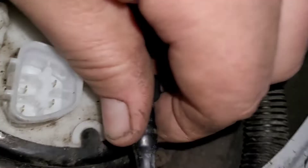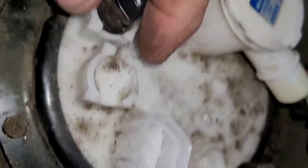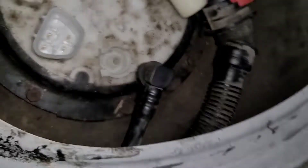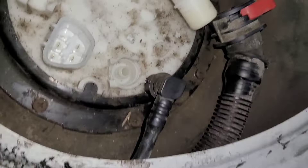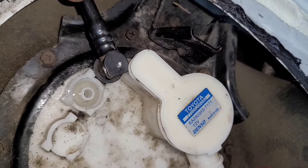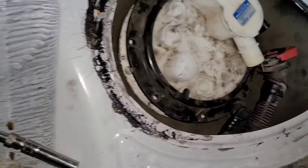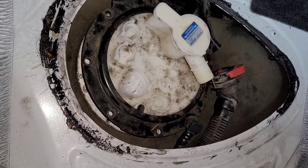Now these lines should come straight up. Tuck them out of the way and then get an eight millimeter and take those screws out. Do not use an electric drill or electric ratchet or anything like that on this — do this by hand — because now you have fuel fumes in here and anything electric gives you sparks. Boom, don't do it. Don't do that; you can cause an explosion.